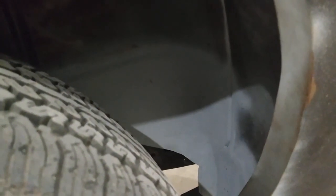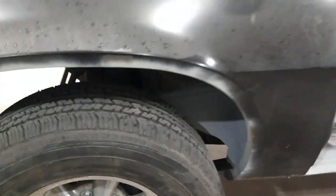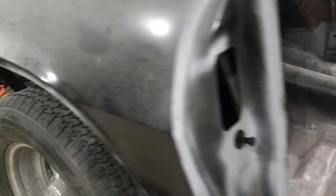The other modification I made was cutting out the seat belt humps and basically flattening them out so I can fit a wider tire. There used to be a hump in here that accounted for the seat belt mount, and if you want to run a wider tire you've got to get rid of that. I didn't want to go with wide wheel tubs — that would be cool, but I have a wife and two kids and I want us all to fit in the car. The seat belt still bolts in there; these aren't retractable belts or anything like that, so it should be fine.